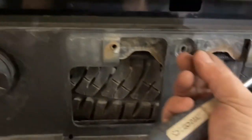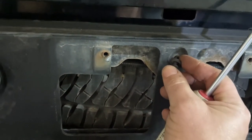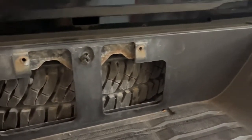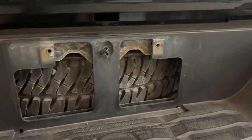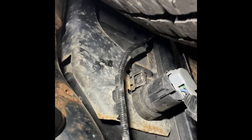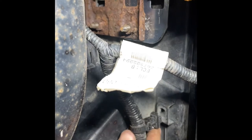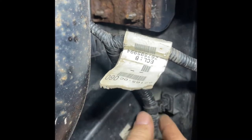The last thing is this plastic screw here that goes right in the middle — that holds the bumper in there. We also need to clip that back in and then clip some of the electronics back in because there was a plug in the back that we unclipped. The trailer hookup is here — I just had to push it in from the back so the clips can engage. For simplicity I unclipped a couple of the wire harnesses, just undid them so they weren't connected to everything.